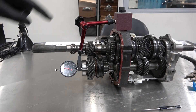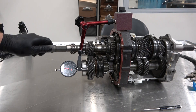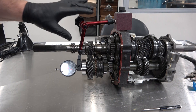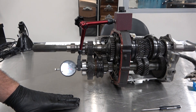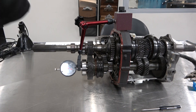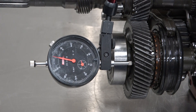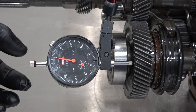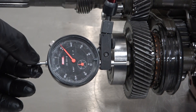The reason I put the magnetic base on the transmission and not on the workbench is because if I move the transmission, the dial indicator stays with it. If the dial indicator is set to the workbench, then moving the transmission would cause a movement in the dial indicator reading. So here we want to make sure that the tip is touching the end of the gear, and that the tip is not loose at the bottom while having some clearance at the top — that means we've got it preloaded.